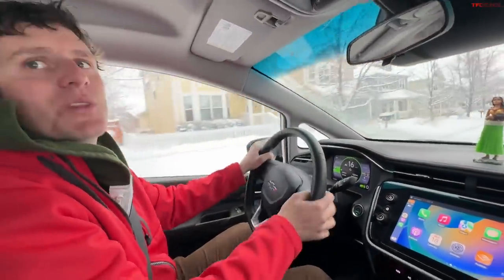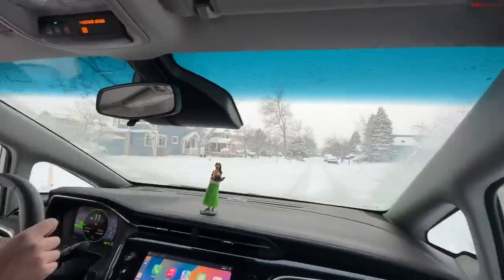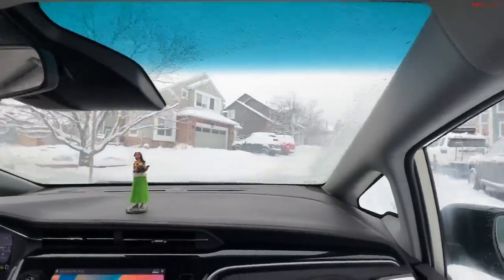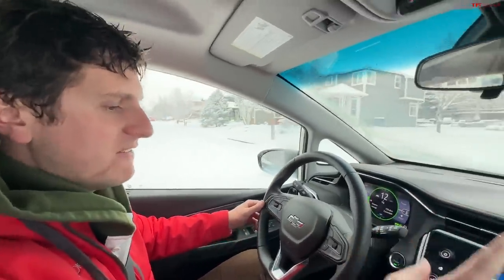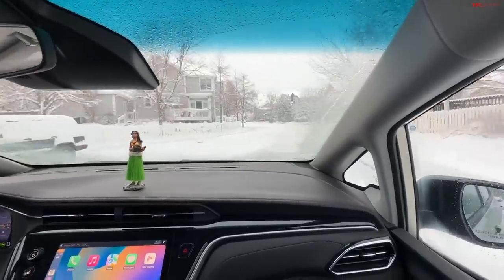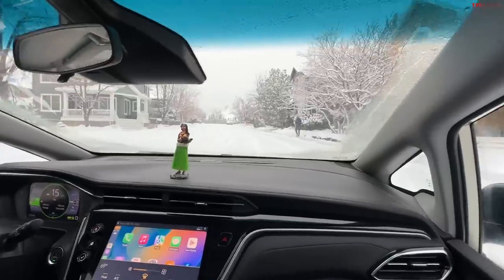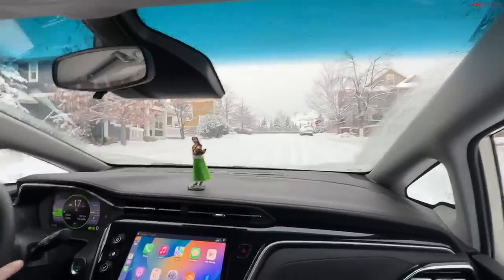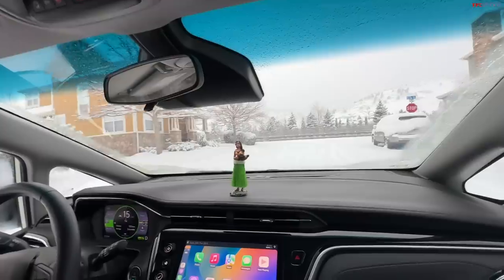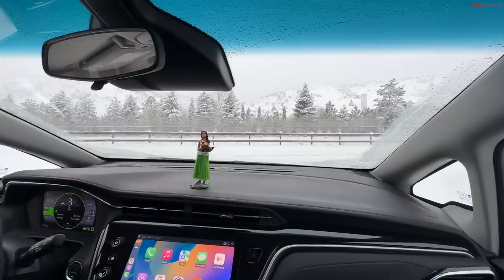So the conclusion: electric vehicles are heavier, which potentially should be better in the snow because you get better traction. But if you're going to be living in Colorado you definitely want snow tires, all-weather tires, or all-wheel drive. Though all-wheel drive won't help you stop or turn — snows or all-weathers are a must. One other thing about this car: it has a huge windshield and it fogs up really quickly, so you have to be pretty liberal with the defrost. I'm also going to ask the next question — how about an affordable all-wheel drive electric car? Because the cheapest ones right now are still in the $40,000 range. All right, there you have it — another TFL snow video, see you next time!